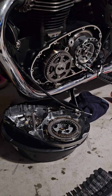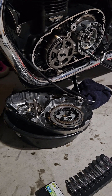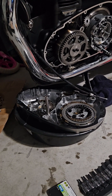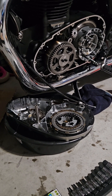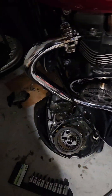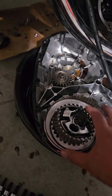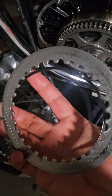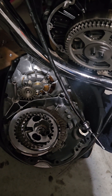Another indication it's the friction discs: when I drained the oil — Rotella I had just changed with no more than 10 miles on it — I opened the cover and the smell of burnt clutch was just apparent. When I initially pulled out the stack, there were wear marks, which is pretty common, but I didn't see any bluing. That tells me the clutch was just in bad shape but hadn't completely slipped.